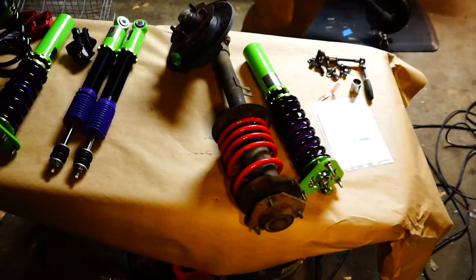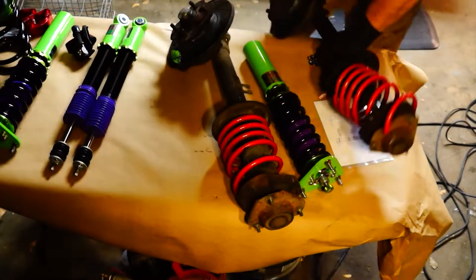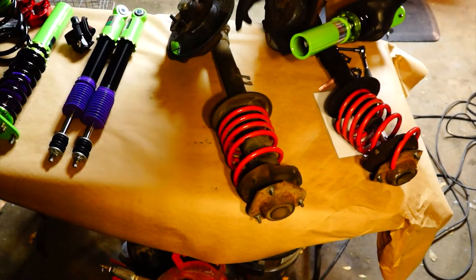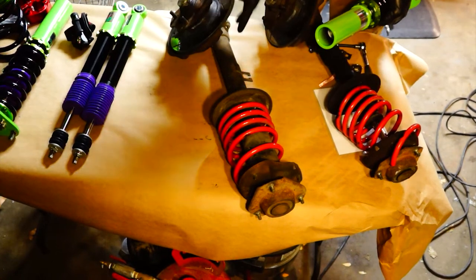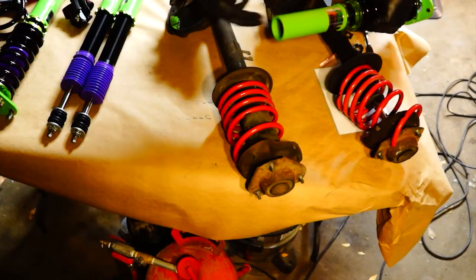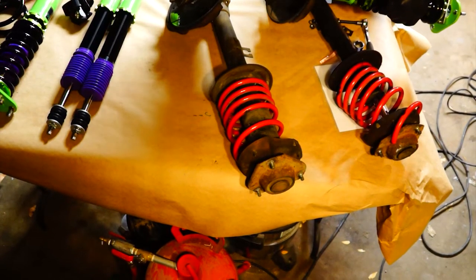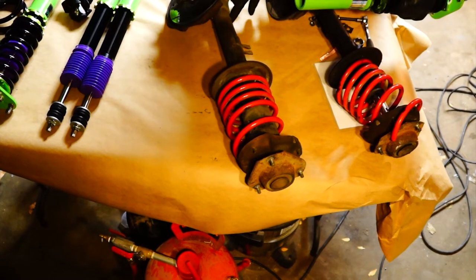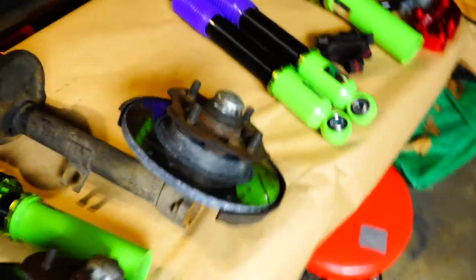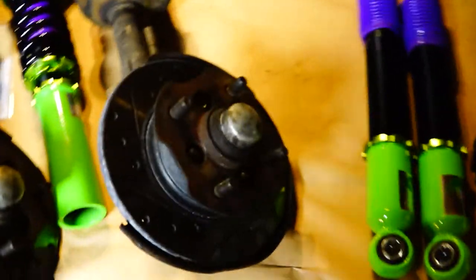So now with both of these out, ready to rock. The way that this works is this diameter here is the same as this outer diameter. So what you do is cut this down 40 millimeters so that it can slide inside. We'll clean all the paint off here so we've got bare metal for a good clean weld. I'm wondering if I'm going to regret not having disassembled the hub while it was still in the car, but we'll figure this out as we start to take it apart.